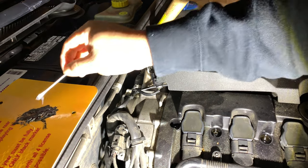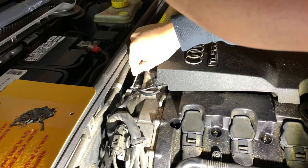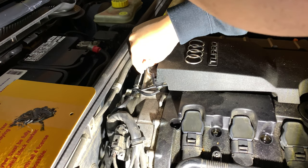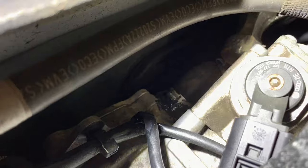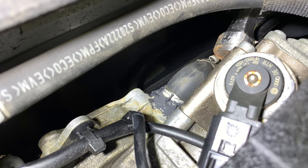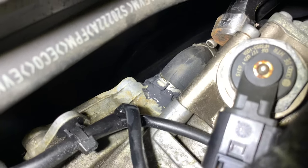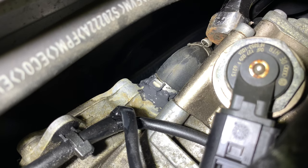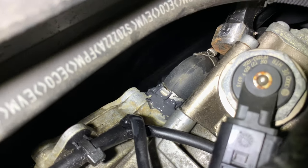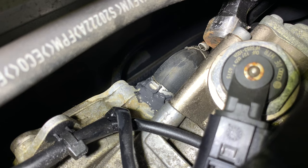As I'm applying this I should also tell you that I used a little engine degreaser and cleaning fluid to clean up this area. There definitely was some stuff on it and you don't want grease or oils to potentially screw up the gluing job. You can see now what I've done — kind of smeared it around. I've used a hammer to hold that hose down against the vacuum pump, keep it flush, and I'm just going to leave that there as this cures. It's holding that plastic flange against the vacuum housing to create a good seal. Only four to six hours to cure but I'll leave it sit overnight.